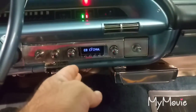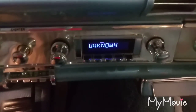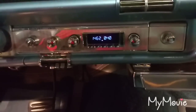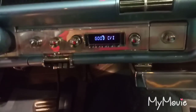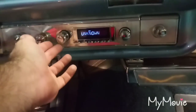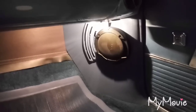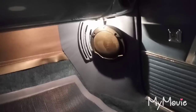Overall the fit and finish is pretty good on this. It has plenty of adjustments — the knobs adjust left and right and also in and out, so you can get it pretty good. I felt like I did the best I could with it. I ended up using the original '64 radio knobs. You do have to drill those out a little bit from the backside, wallow them out so they fit over the shafts, and then they stay on with a little Allen set screw. They do come with different style knobs if you want, but I used these that came with the radio. I ended up using these custom audio sound kick panels, six and a half inch. They're okay, decent. I ended up dying them — they come black plastic — dying them to match the floor mats with some rattle can Dupli-Color.